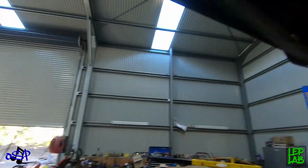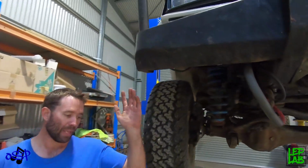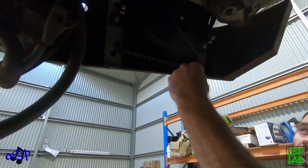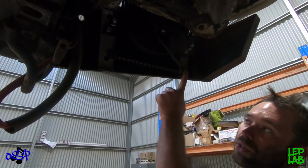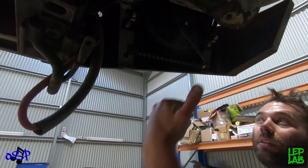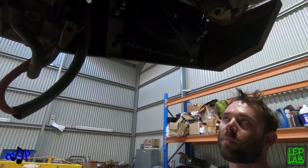Alrighty, so the oil coolers have also been mounted on the cruiser here, mounted to the bar. It's not where we originally envisioned them going, but it's the only place they can fit, and it's the only way they can fit. The original idea was to actually have them lay the other way, so long ways like that, and sit up in there, and we thought that they'd probably sit down just a little bit, and the plan was just to make another bar that runs across there to protect them. But with the thermo switch in the top and then your fittings in the bottom, when we actually dummied it up, they stuck out way too far. They were down here somewhere, and for four-wheel driving it would have just been way too vulnerable having them sit that low, and it also messes up your approach angles and all sorts of stuff.